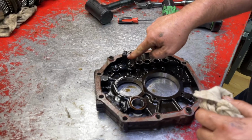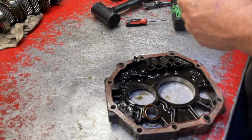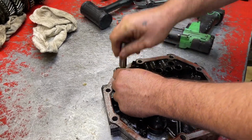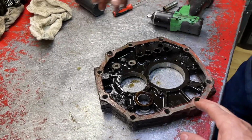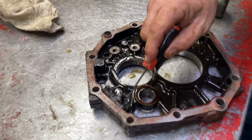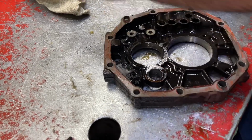And then we have a couple pieces left. You don't need to take this off, but we do just for cleaning purposes. That's what the reverse fork pivots on. It's 2 12 millimeter bolts. What is this piece called? That's the center plate. Center plate, okay. Yeah. You can see the magnet, see all that funk? That's all metal debris? Yep.